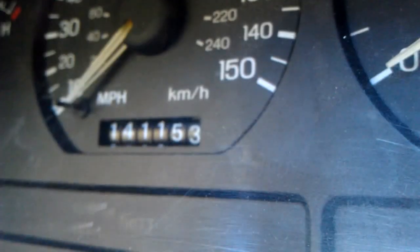You want to get back into the car. This first test is going to be the key on engine off test, to pull the stored codes. So what you want to do is get a little pad of paper like I got here, and get yourself a pen so you can write down the codes as they flash. Set it up right here.